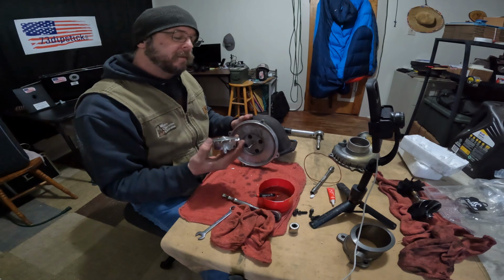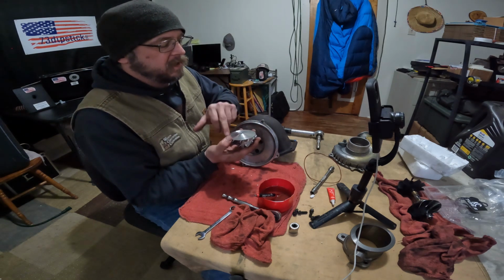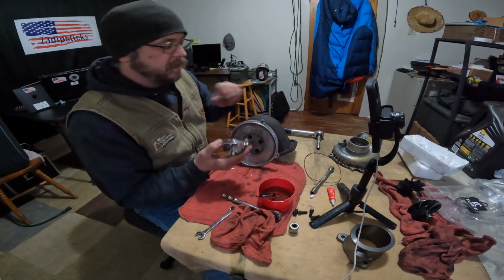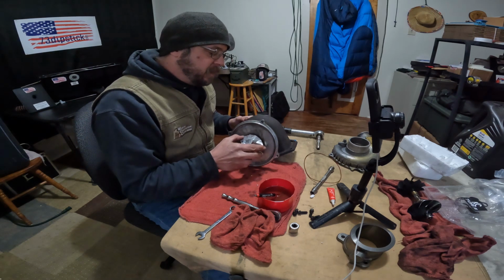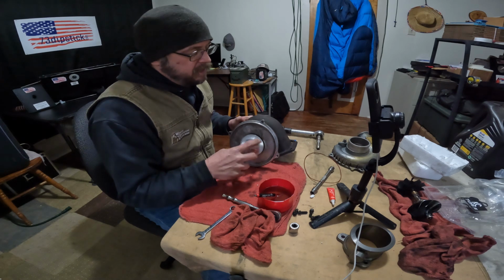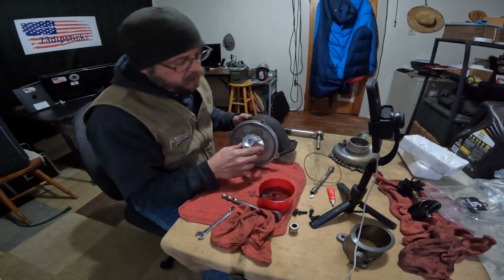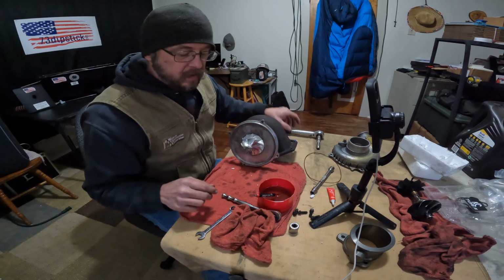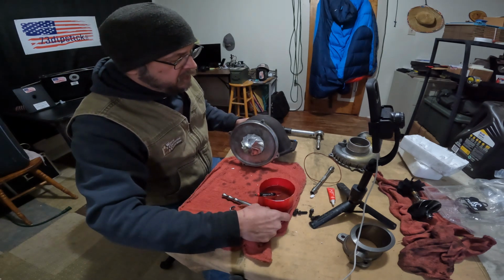So now you take your wheel, which has all the balancing marks. Charlie talks about this extensively. These are not mess ups. These are not bad castings. That is how the machine, when they balanced the wheel, tells it to balance. That's how they know where the balance on the wheel is at that point. The grinding mark here, they're probably on the exhaust side too. I didn't show anybody that, but I can guarantee that's where they are,